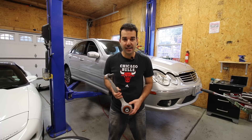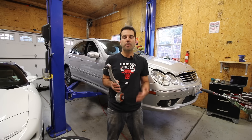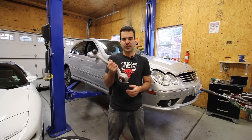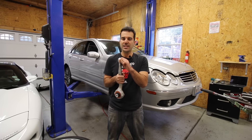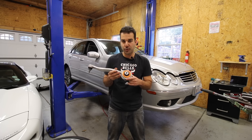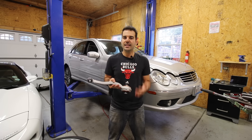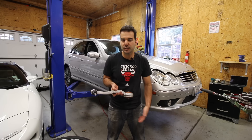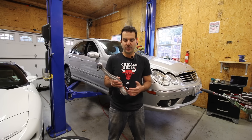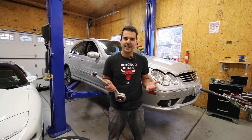Next up, we have method number four. In this method, we're going to be replacing the entire arm. This would apply to people that have a bad ball joint at the other end — when this is still on your car, all you do is tug up and down on the arm, and if you see any movement at all in that joint, you need to replace the entire arm. The bushing is already pressed into the new arm — these are about $100 each. This would also apply to people with higher mileage or someone that just really loves their car and wants a nice new shiny arm. Figure $200 and you've got two brand new arms with new joints and new bushings. That's not a bad deal either.